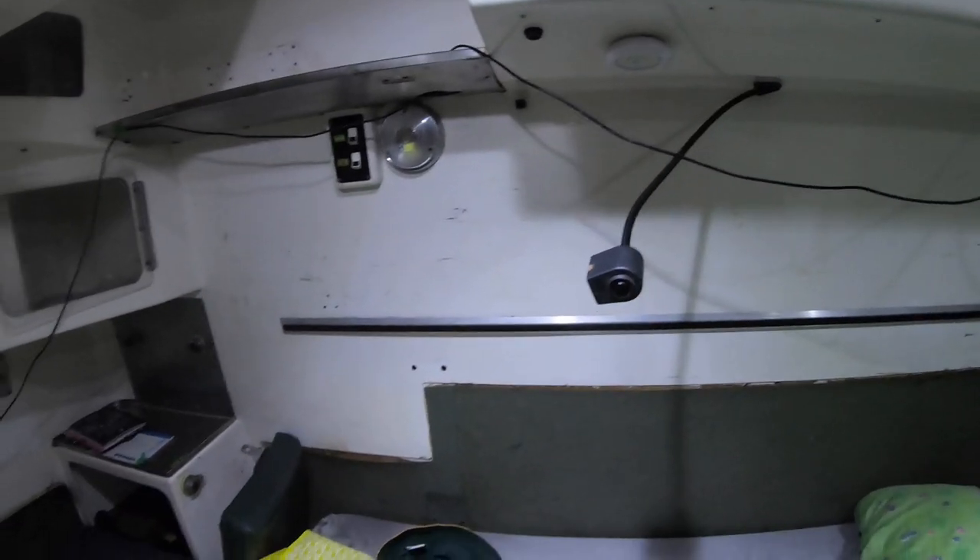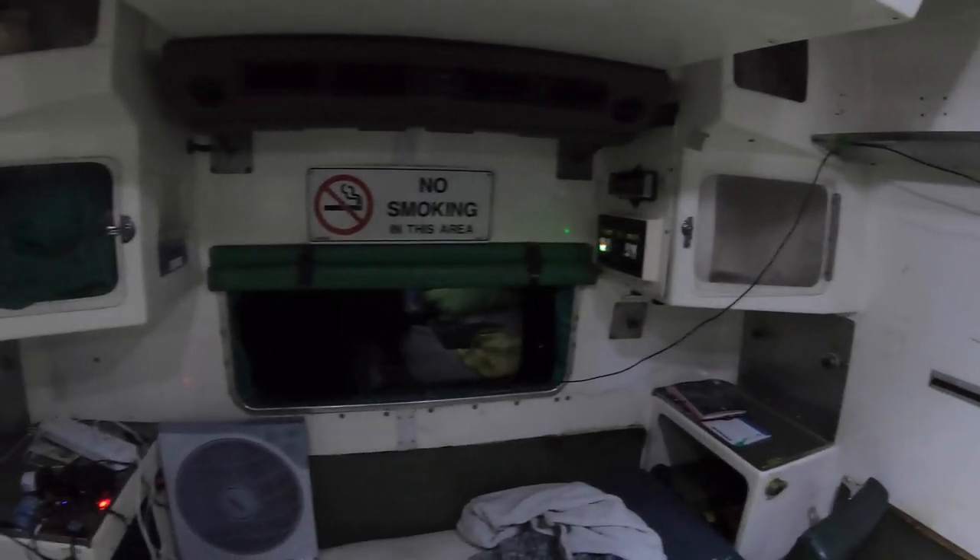That's good and it certainly drops our power usage way down. Let's have a look at what our power usage is doing - there's no solar at the moment. I'm pulling 270 milliamps. Let's turn all the main lights on. With all the lights on we're pulling about 400 milliamps at 24 volts.